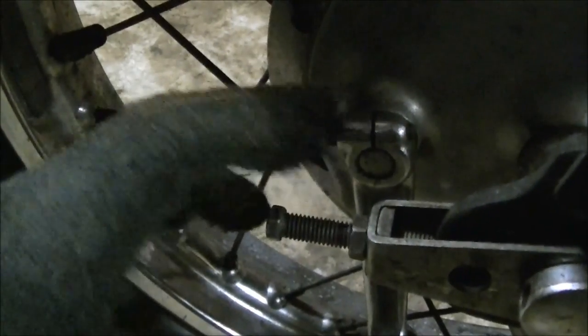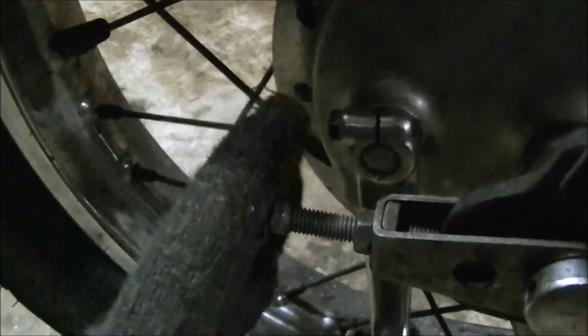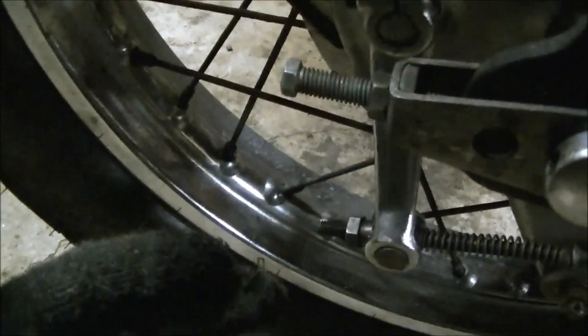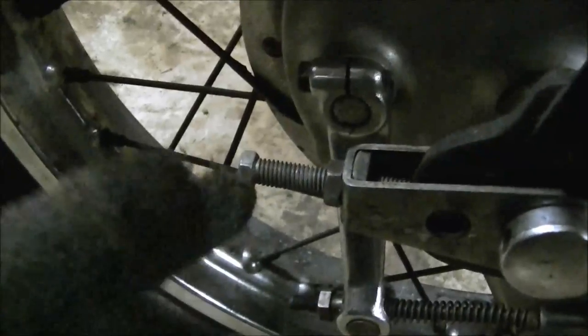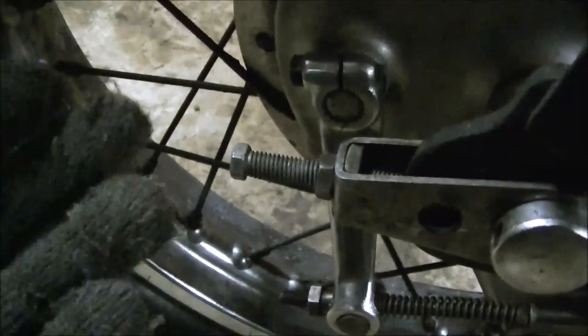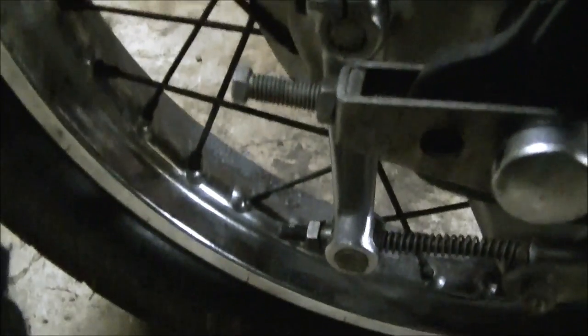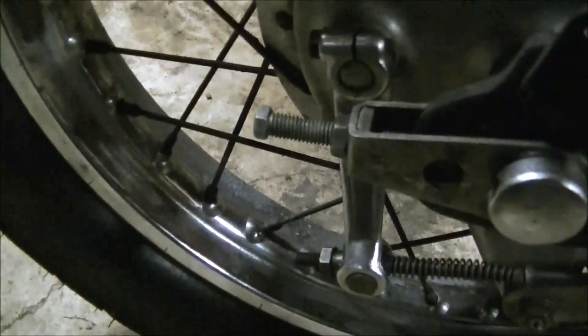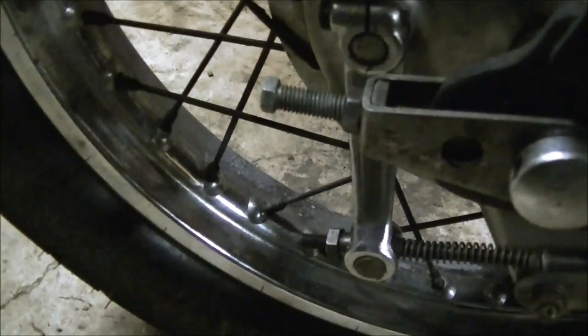You either tighten or loosen this nut. And if you still can't get the range you're looking for, you can take the entire lever off this assembly, rotate it on the spline, and start it at a different position. But if it was already working before, you probably don't need to do this — it really just has to do with if you completely disassembled the bike. So that's a pretty simple mechanism, pretty easy to adjust.